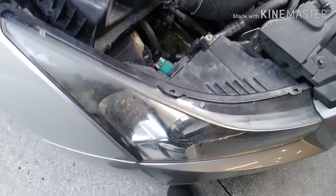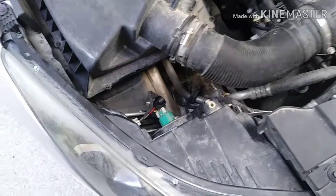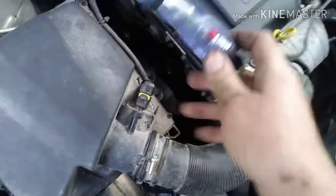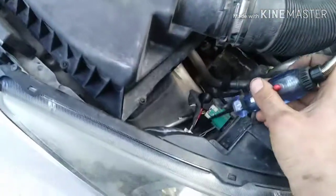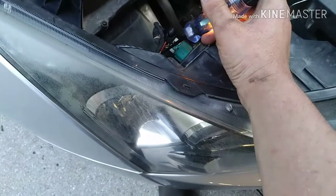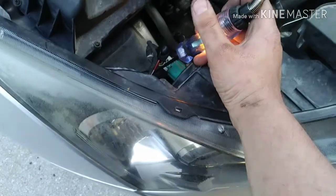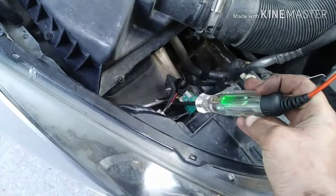Another example — this will be highly unlikely, but if you're ever in a situation where you need to send power, this Snap-on LED test light specifically has a jump lead capability. I hook up here with this hooked up to power, I found ground, and if I jump it, I can do that. But the LED test light — as you can see, we just found ground — you can't do anything like that. But food for thought.